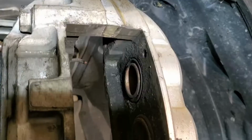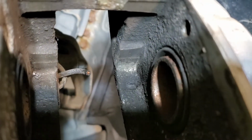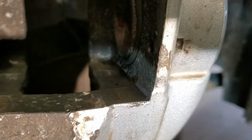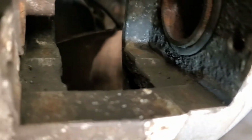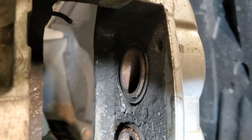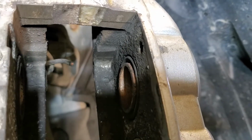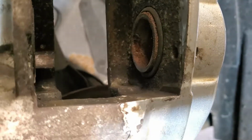All right. I think it's really important to get those contact points cleaned out where the brakes will slide or contact against. They're supposed to be free. I've cleaned them with brake cleaner. You can see a little bit of rust on the surface of where the brake pads sit. So this is where I'm going to use anti-seize and some anti-squeak on the brake pads. So it just gives you a sense of some of the challenges with this set of brakes. They're pretty straightforward, but they need to be able to move freely. And so anyway, I'm going to add some anti-seize and start the assembly.